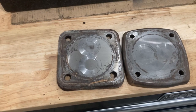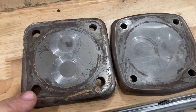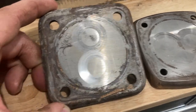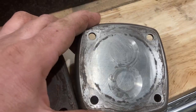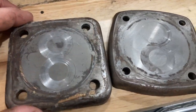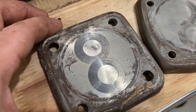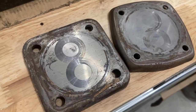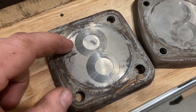Even though the pump has passed the tests, there is something else we're going to want to look at, and that is the pump cover itself. I save all the pump covers that I get. These ones are in pretty rough shape - if a pump has been run for any amount of time you will see these wear marks on the face of the cover. It is very important that you don't leave it like that before you reinstall it. You either need to get a new pump cover, or the solution I have is to surface grind the pump cover to make sure it's completely flat. The reason for that is you will develop end play - remember how we checked the end play a moment ago.